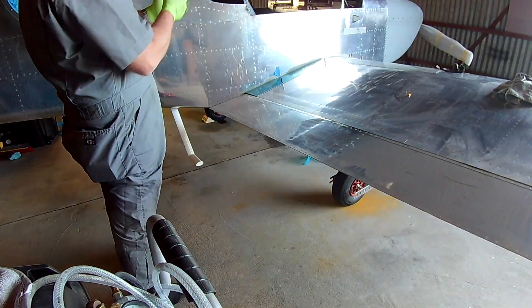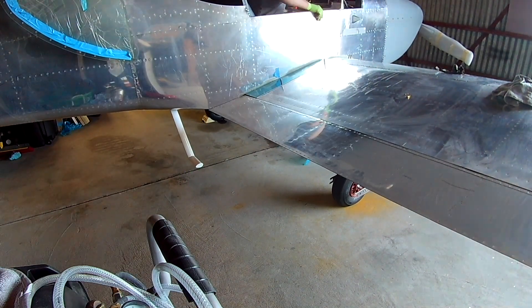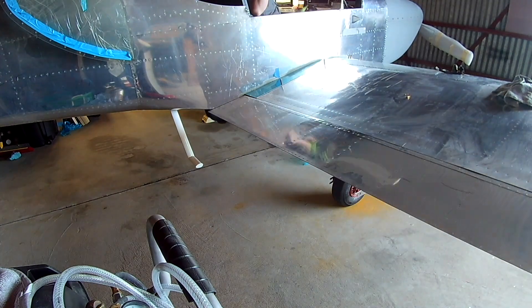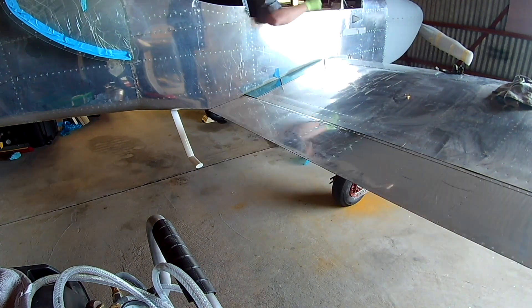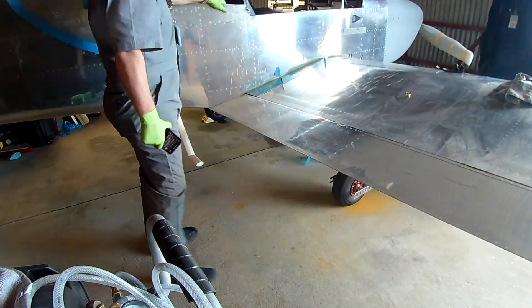But first, let's show a small milestone — the right flap is hooked up. Let's get in that plane and make the flaps work. Look at that. To put the flaps on, all you have to do is get a little piece of tapped hex bar, which is 10-32 thread, and then there are a couple of AN4 eyebolts that go in on each end, you hook it up, and that's it. Flaps hooked up.